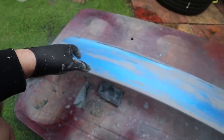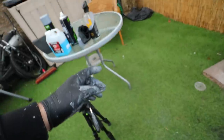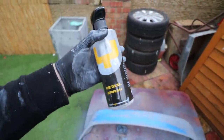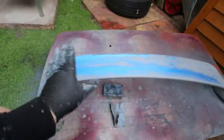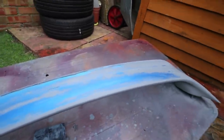Luckily I caught it where it only had a dust coat and a light first coat on it, so it wasn't too thick — it didn't take much to get it off. I used 800 grit and it came off pretty easily. I'm using the Yum Kaz Detail Spray as a lubricant for wet sanding. It's probably not designed for it, but it's very slick and works really well. My plan is to wet sand the whole thing and get rid of as many of these scratches as I can. When it comes to painting, preparation is key. If you're not happy with how you've prepped it, always stop yourself before you go too far and make sure you're happy before you put that base coat on — because then there's really no going back.